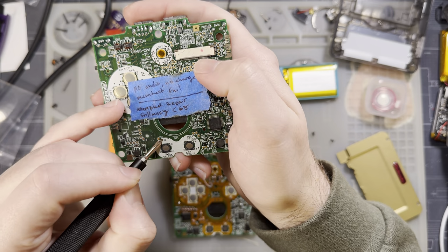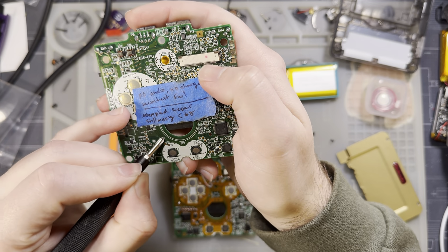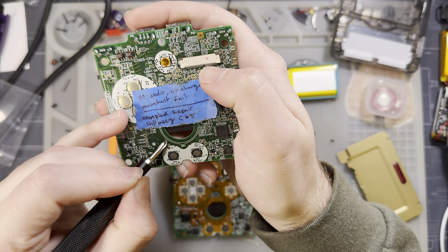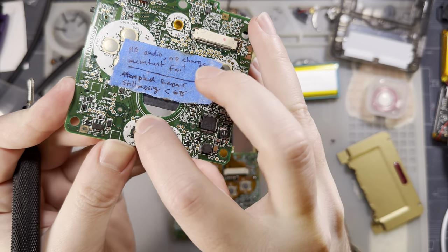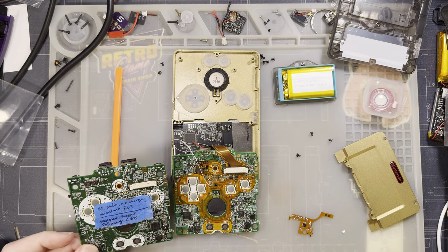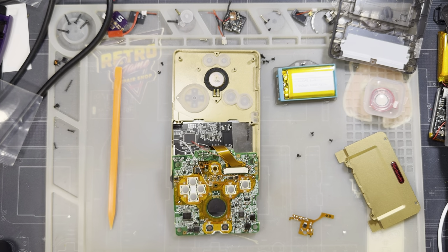I don't recommend soldering to that one because that's going to make the membrane sit funky. So the instructions recommend scratching a little bit of the mask up here instead and then soldering to that. A screwdriver is not the proper tool for this, but this is a dead board and I just don't care. But just scratch it up like that and then you can solder to it no problem. But this is below the LED mod. So this model is not compatible with the amp and the LED mod. Pick one or get creative with your wiring.